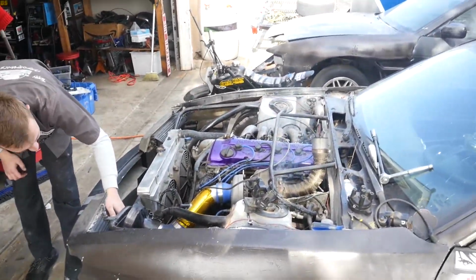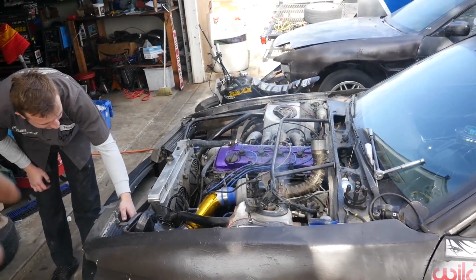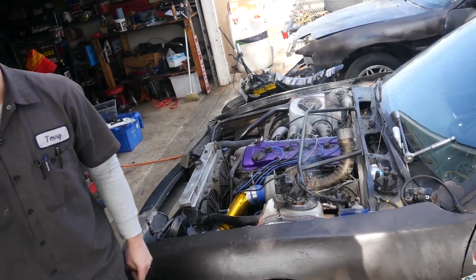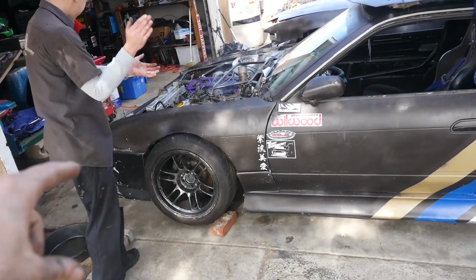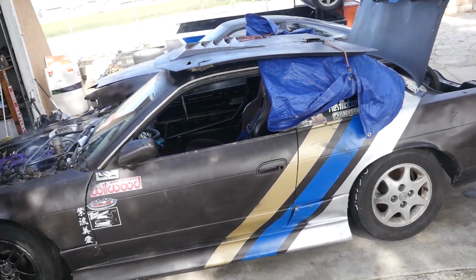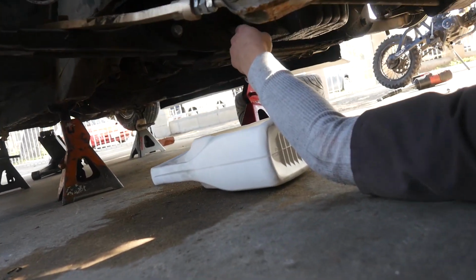So we'll just be doing a fluid change, so coolant, and we'll be doing the oil and the oil filter. Am I right? We're gonna be doing that on your car? Yeah, and a nut and bolt check as well. So we'll be lifting the cars up, checking all the nuts and bolts, the front subframes, lower control arms, rear subframes, diff, axles, all that stuff, because over time it gets loose. We're gonna be running down the problems, aka leaks.